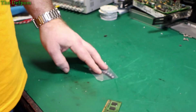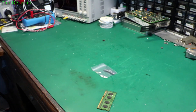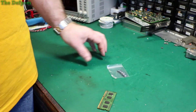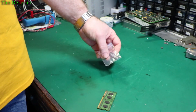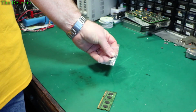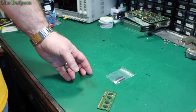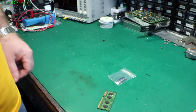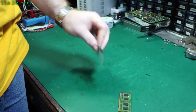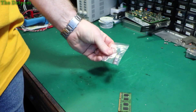I've got a MacBook 2012 which I'm working on right now — one of the ones I've been working on. It's a Retina. I found it has some water or liquid damage on it, and it's actually eaten right through a via on the board. I think it's blown a MOSFET, so I'm going to replace it. As I haven't worked on this particular model computer before, it's a bit of an experience. I really want to get it working because I want to make that my editing machine when I'm away. It's an IR6802 device — I'm not sure that's the complete code, there might be more to it than that.